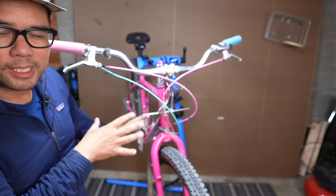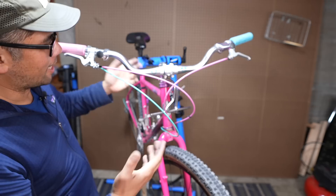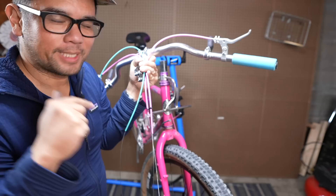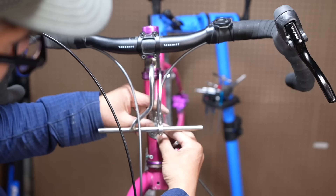The next step is to really take advantage of these double-ended ferrules. I'm going to set up a second set of handlebars — the drop bars that I have somewhere. This is where the magic should happen: as I remove this handlebar, these short segments should stay on, but I'll still have the ability to splice on different bars with different housing. So instead of carrying a whole different set of bars with full-length housing, this shorter segment is all you have to contend with. Now let's get weirder and put in the drop bars. So we've got our drop bars here — I'll pull out the cables, eyeball where to cut them, and hopefully they'll splice into the ends we already have.